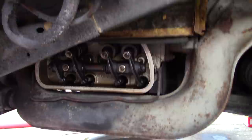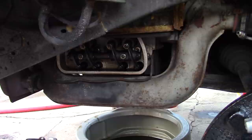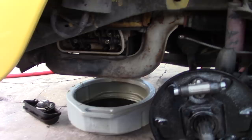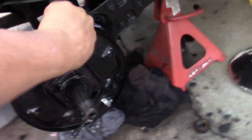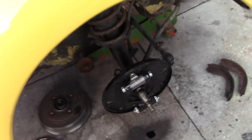I cut the valve covers off and drained the oil. The engine is in excellent shape — looks like it was a factory long block or rebuilt by somebody who really cared. It has all new head bolts and hardware and appears to be a really sweet motor. I changed the oil and it didn't look very old — probably more of an age thing than a mileage thing. I also found a vacuum leak: the intake boots were loose, so I tightened those up.